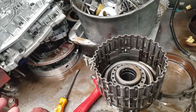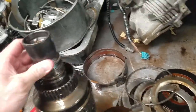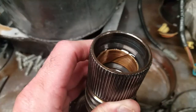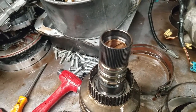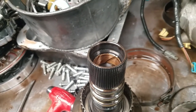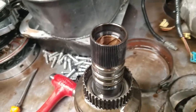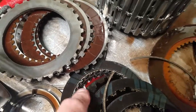I have some pictures that I'll forward along to show that. You can look at the end of this input drum here — you see how the bushing has a bit of wear. That's a pretty good indication that there was material between the inner bore of that bushing and the component rotating inside of it. In addition, you can see that there's some delamination of friction material.